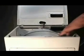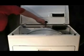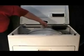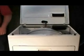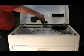Connect the door switch to the wire harness. Remove the holding wire from the tumbler and install the baffle holding screw. Again, if you're using a power tool, be careful you don't strip the hole on the baffle.